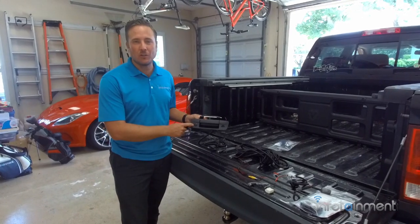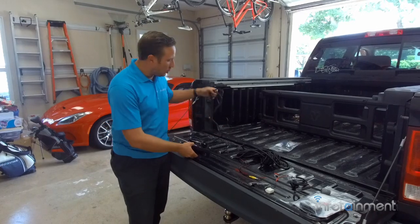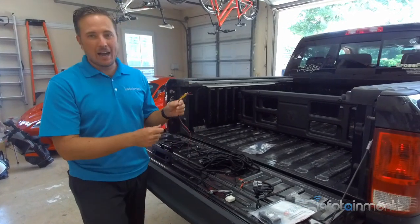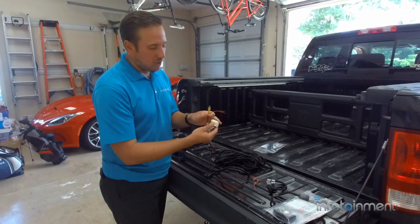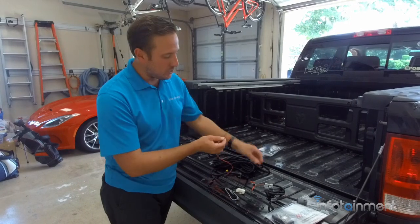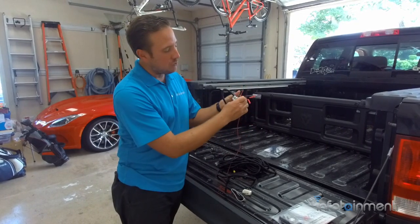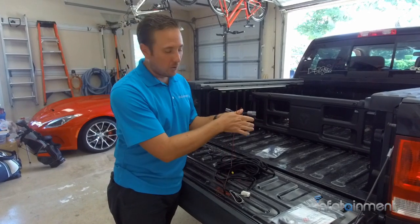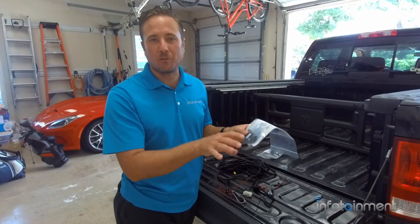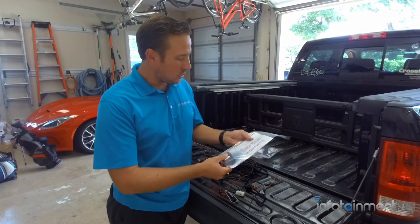This happens to be in the tailgate handle here. Installation process is very easy — you're just going to swap and remove the factory tailgate handle, install our kit. The loom goes down and plugs into a longer loom, then feeds into the cab behind the radio to plug into your touchscreen radio. You'll have an RCA interface, and then power and ground — we make it very easy using the EZDC kit we invented, which acts as an intermediary between your cigarette lighter and gives you power and ground. The very last step is to run the OBD Genie programmer in the OBD2 port to activate the backup camera feature on the vehicle's BCM, so when you put the vehicle in reverse the image appears on your screen. Let's get started.